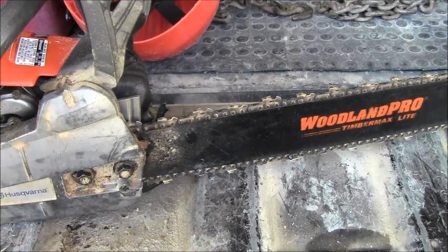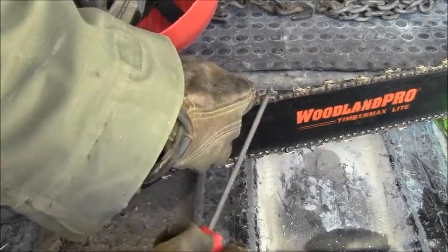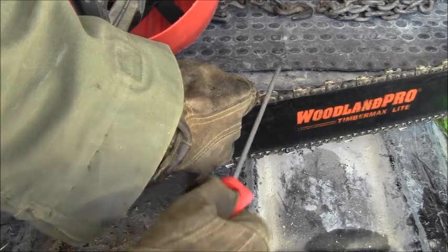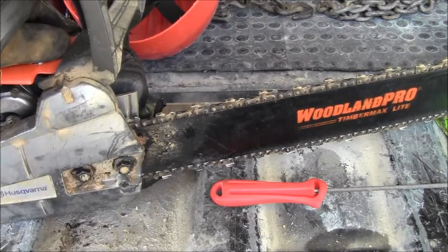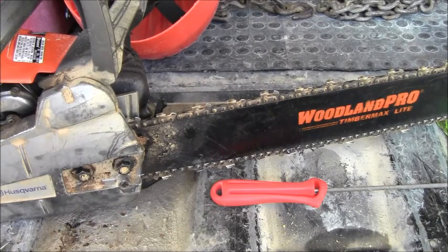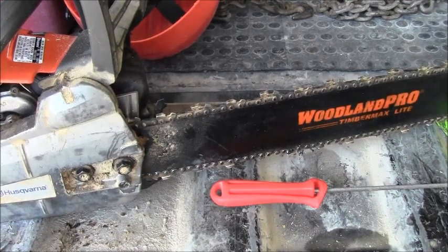After I sharpen I'll top up my fuel and oil and I'm ready to go back out and cut. If you don't know how to sharpen, look up some videos — I've been sharpening my own saws for years. I do it on the ground, on a stump, or on the tailgate. Use a handle so you get a full stroke and aren't putting the tang of the file through your hand. Whenever you're handling the chain, have your gloves on — a file makes these teeth razor sharp. Thanks for watching!